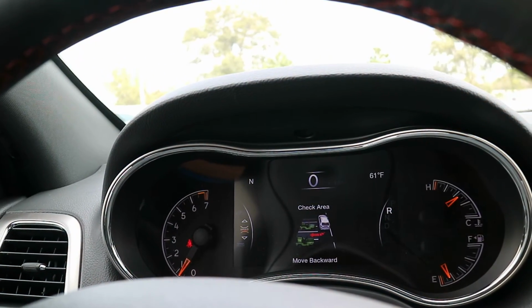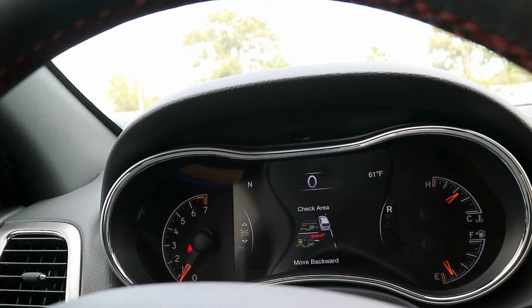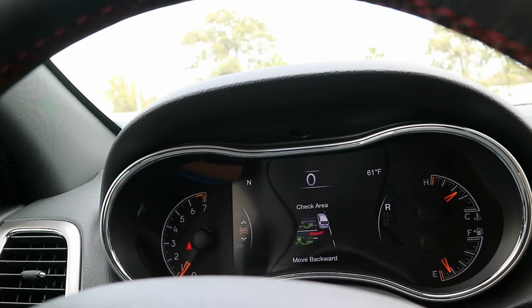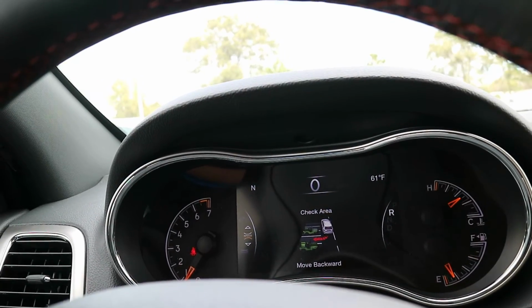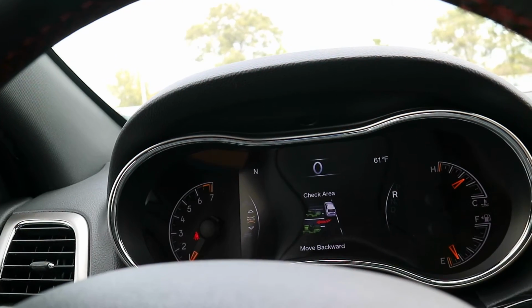When this thing dings and says space found, your hands are off the steering wheel at that point, and you do not put your hands back on the steering wheel unless you want to disengage the system. That is how to make this thing stop doing this. Alright? It will disengage it automatically. One finger on the steering wheel kills it.